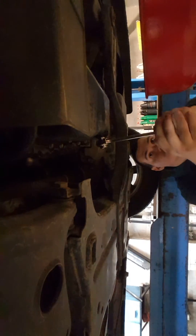NAPA 21348, that's what we use. New oil filter in place. As you can see, 5w20 oil — I'll fill it up real quick. We just filled it up and it took 5 quarts of 5w20.